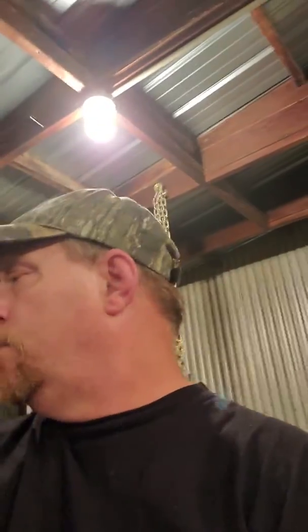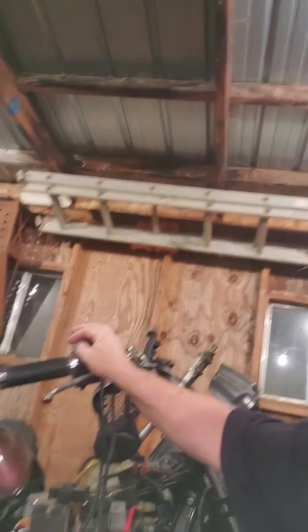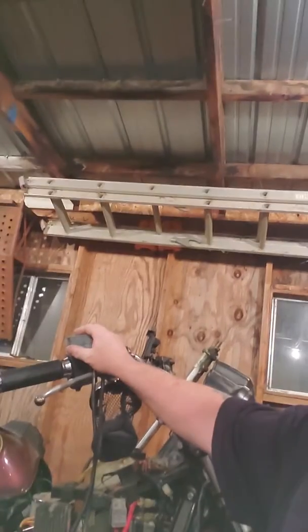The fairing is all together. It doesn't look like a spaghetti bowl sticking out of it anymore. These units right here — the switches for the Clarion Type 2 radio and the CB — I had three sets and they were all not very good. I purchased some CB components from a gentleman selling them as a wiring package; they weren't any good either. So I took all four sets apart, found all the parts that were still good, and made one good set. This set works perfectly fine now. I went out and purchased an ohmmeter to make sure that what you do here corresponds to what you do up here — they work now.